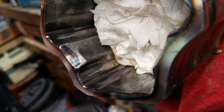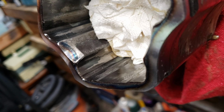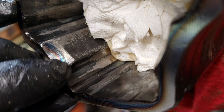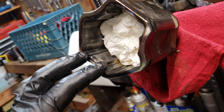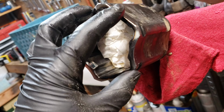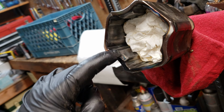Alright guys, I'll give you an update on what's going on here. So, the CV shafts, because they're longer and the long travel has more travel, it's actually hitting right here and right here on the inner, where that is clearanced. So what I'm going to do is clearance these a little bit more through the inner of the outer. It didn't blow this portion of the tripod up, or the tripod itself, or crack the shaft, so it's obviously not hitting too much.